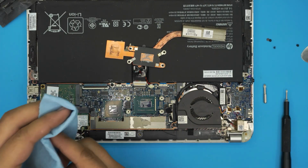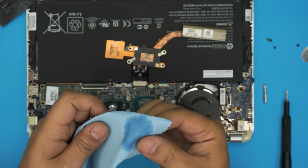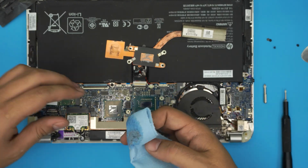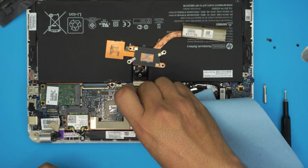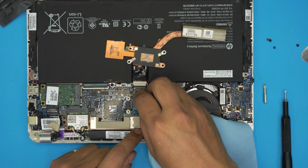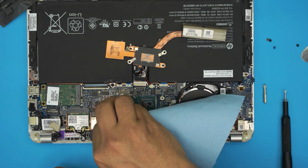These are really suitable for cleaning the CPUs and GPUs. You need 100% or 95% isopropyl alcohol, and clean up the die, the CPU, nicely. The reason I use these towels is because they will not damage the components. Once you put alcohol, it will not rip the capacitor, it will just rip the towel. So once you clean it up nicely, do the other chip.